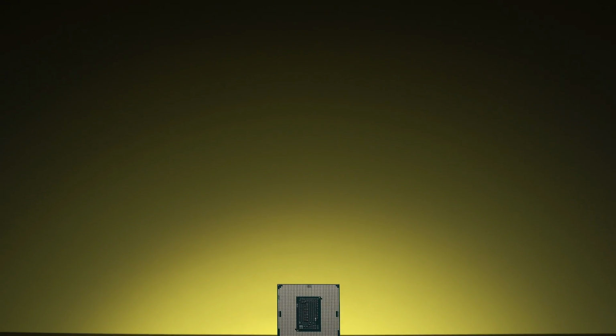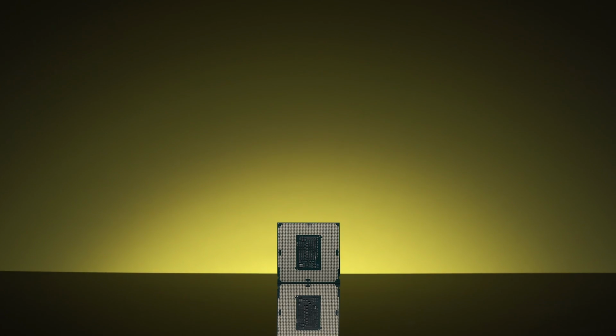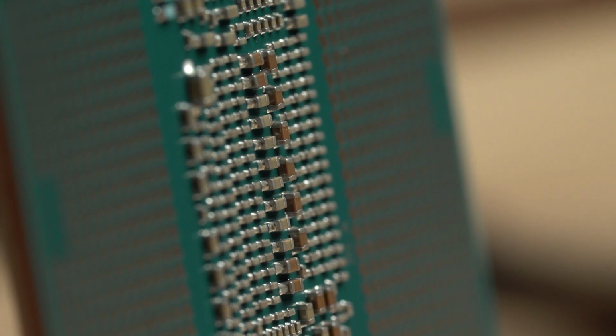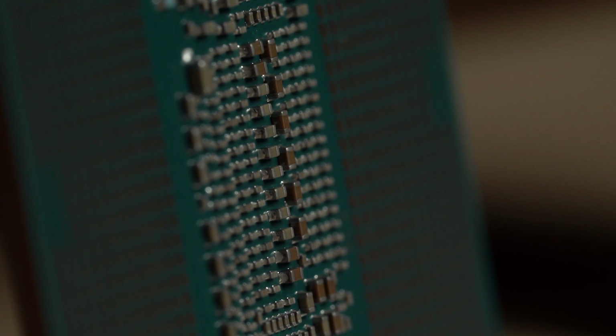Intel's 9th Gen series of processors are here, bringing about unprecedented overclocking capabilities due to a brand new IHS-based heatsink design that is going to allow for 5 GHz plus overclocking in real-world cooling solutions. In addition to this, you've got 4 GHz plus DRAM overclocking, and you're going to have a lot of granularity control to really be able to push these CPUs to the highest level seen in the mainstream series of processors.